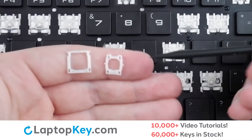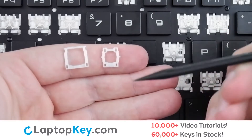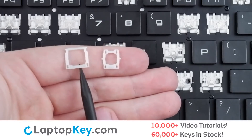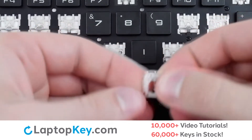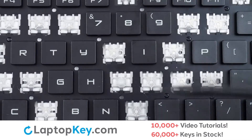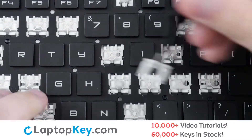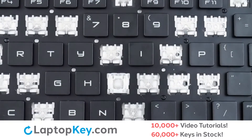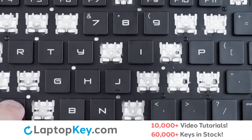To reassemble your clips, we'll begin with the top clip which has two thin holes at the top edge and two smaller holes at the bottom. For the bottom clip there are two holes and an upward facing notch on the bottom edge. Connect the two halves together, ensuring the plastic support arms of the top clip go into the holes of the bottom. Then using metal hooks here, here, here, and here, we will lay the clip down bottom first, ensuring it's hooked on. Press at the top, replace our key cap with a firm press, and we're functional.